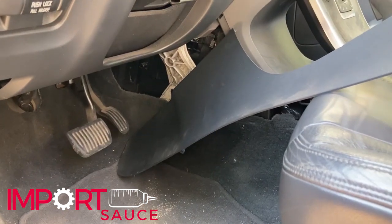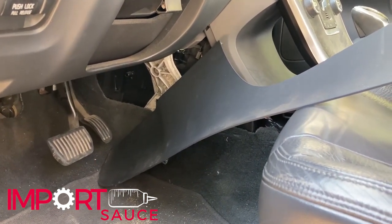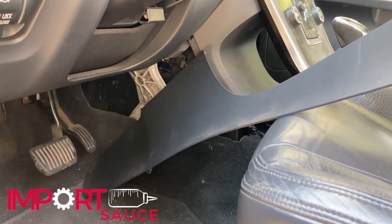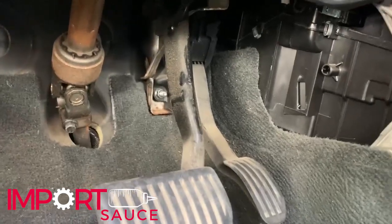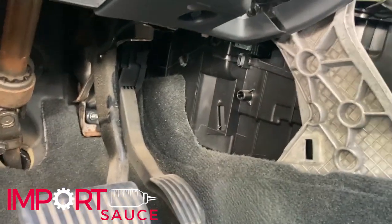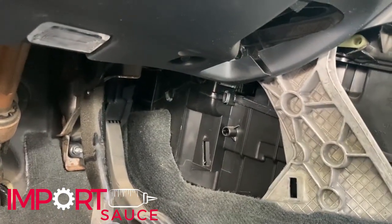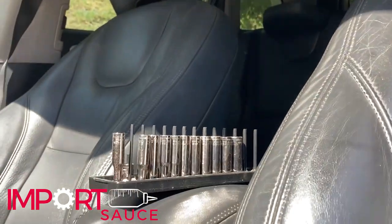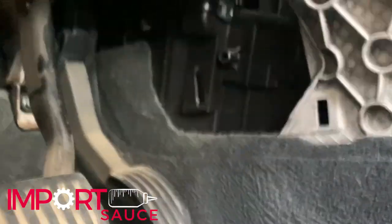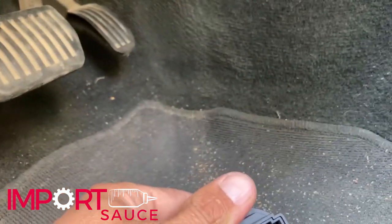The instructions for the S60 were a little more involved, but I think we're going to get lucky here. The steps involved taking off this kick panel - that's easy, just these standard push clips, pry that out and get it out of the way. For the S60 the next step was to remove the gas pedal, which is also the instructions for the S40 for doing the cabin filter. I found that I can actually do that and squeeze everything together without removing that. We did bring a set of millimeter sockets, but when I look at the resistor and see it's a four-prong plug, it's going to be pretty large.